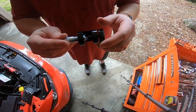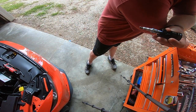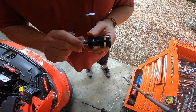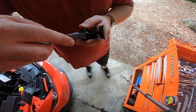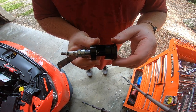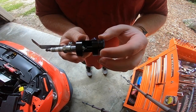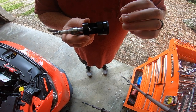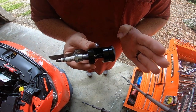What that does is press down basically on the strap. I've already gapped this plug so I'm not going to gap it again, but what you're basically going to do is take your feeler gauge — that's how I gap my plugs. Turn that out so you can get to it, stick your feeler gauge in there just like that, feel where it is, and then if it's too loose you're going to turn this down and that's going to press on the strap. What I did was kind of hold the feeler gauge in there as I turned the thumb screw down against the strap. The strap will bend like it should.